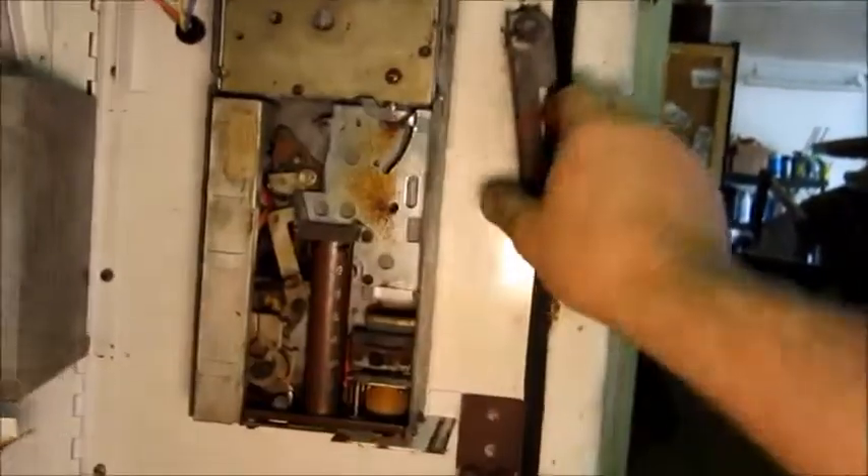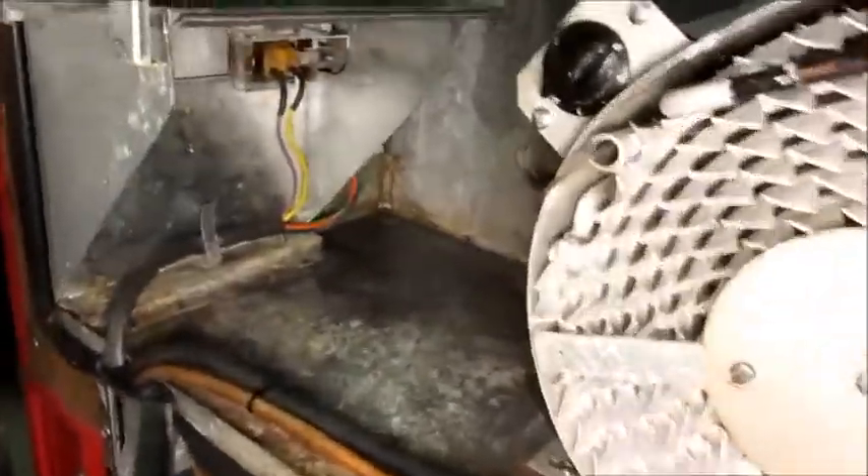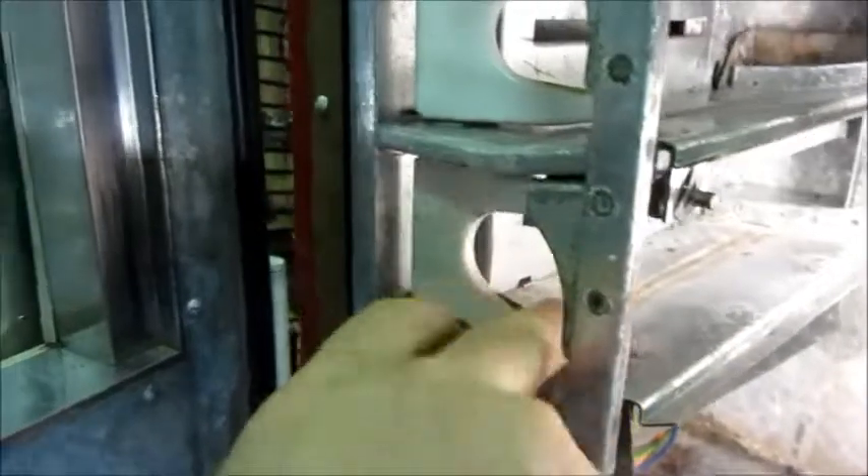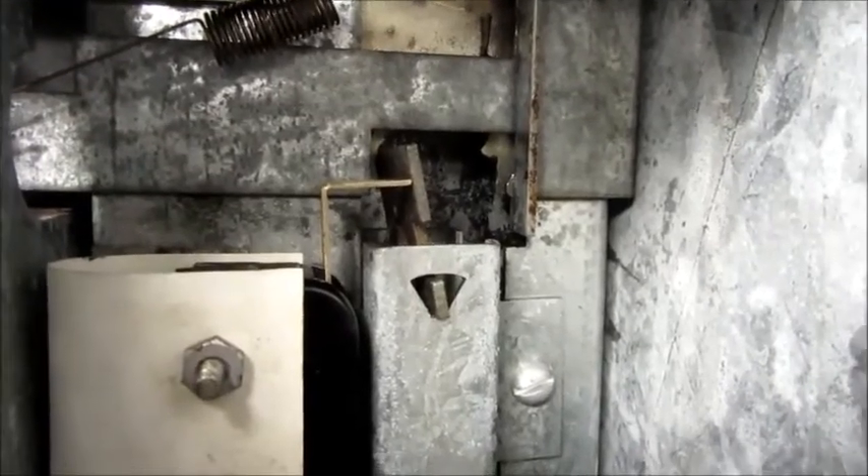So how does that lock system work? It's an electric solenoid. You're going to have to bear with the noise because you can't turn the fan off from the evaporator. That's the solenoid that unlocks the bottles. If I push it in manually, it'll unlock it. So right now it's locked — if I push this one time manually, now it'll work. That's the actual latch mechanism. If I unlock it, see there's a bar that stays to the left. And when I pull out a bottle, it resets it. The solenoid fires, and then there's a switch that's activated to make the light come on. When the bottle rack is pulled out, it's reset.